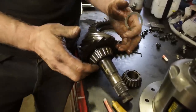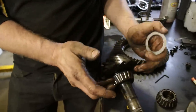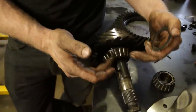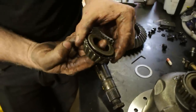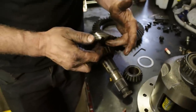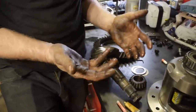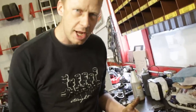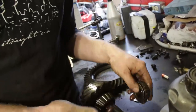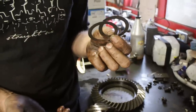If you don't feel like fighting with this bearing and you're doing this at two in the morning like most normal gearheads, if you want to try and save this bearing, you can take this off, take it to a machine shop and get them to ream just a little bit off the inside of that bearing. That allows you to slide your bearing in off and on a couple of times. Just get them to take a little die grinder and clean off the inside so these bearings slide easily on the shaft - that allows you to change the amount of shims going behind your pinion. Local truck shops will have these bearings for generally 10 to 15 bucks. If you feel lucky, you can leave this bearing on and take a stab at how many shims you need on your new ring and pinion - generally about half is a good place to start.